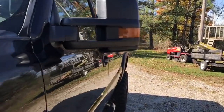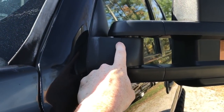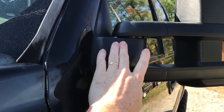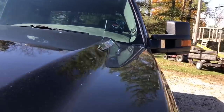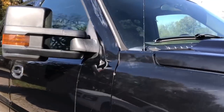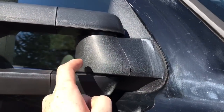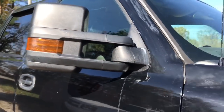The way we're gonna do this is you're gonna take a flathead screwdriver and just ever so gently pry up a little bit so you can actually pop this cover off right here. Once you do that you're gonna have these set bolts that are inside, and you're gonna go ahead and add washers to the top bolts. There are four bolts on each end — one, two, three, four. Let me show you guys how to get to that right now.